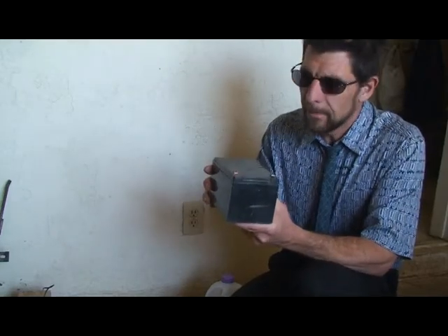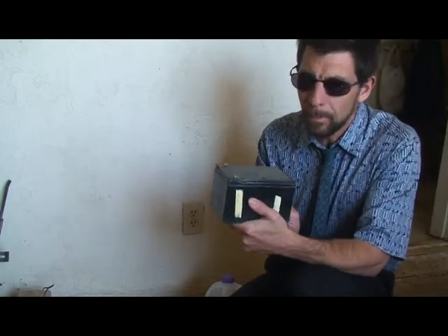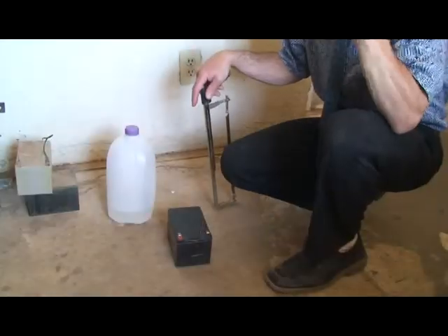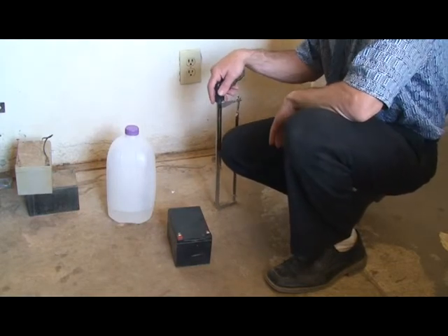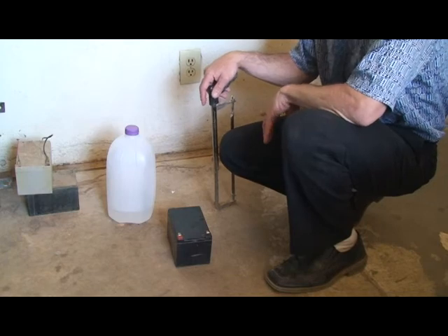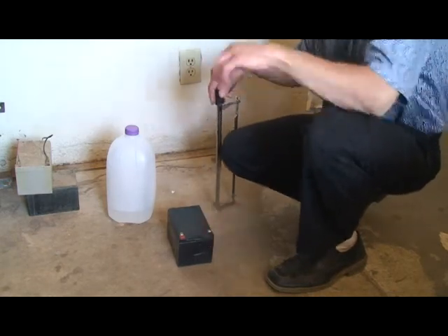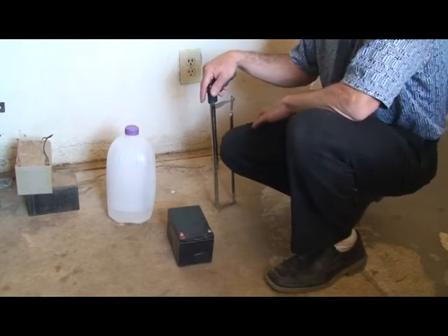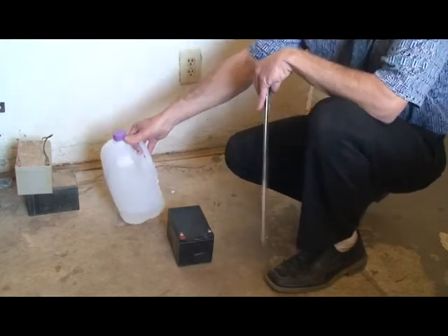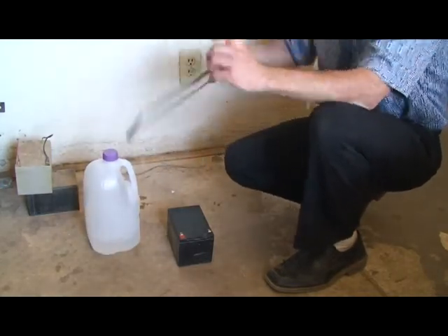Right here, I've got this battery that needs to be refurbished. So rather than buy a new one, we're going to try and make this one work properly. I have about 12 of these and they either need to be thrown in the trash or refurbished. These are batteries that you typically don't refill — they're maintenance-free batteries — but they probably dried up. And once they have some distilled water reestablished with them, they're very likely to work just fine.